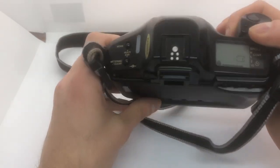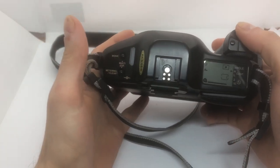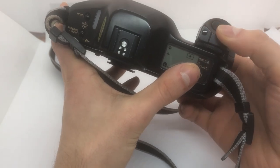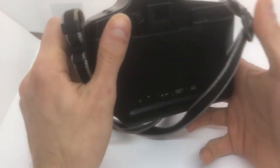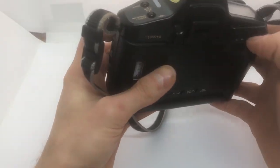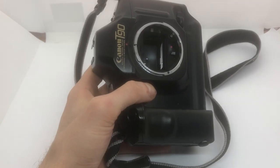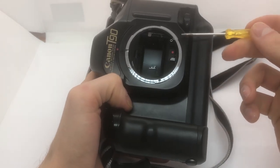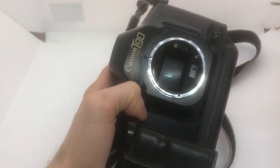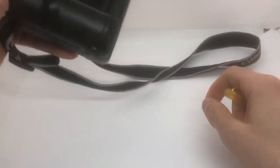The problem is - this seems to be a normal problem with this camera. If I want to shoot, you have this blinking cursor error. I just watched a YouTube video and I will watch it side by side because I've never done this before. But it seems pretty easy to fix. It's just because there's a magnet here and this magnet is loose, so it's not magnetized and you have to re-magnetize it or tighten some screws. That's it, pretty simple.